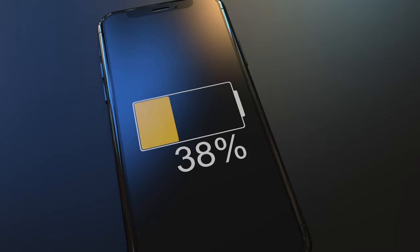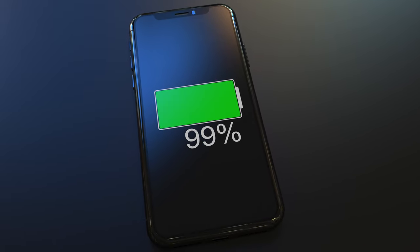Before the most recent DJI Fly app, this was a feature that iOS devices had to turn on and off. Then they released a new version where they took it away completely — you could not charge your phone at all from the controller. Now they've put it back, but iOS and Android devices will now automatically charge from the battery off the controller when it's plugged in. The only caveat is you can't turn this on and off, so your controller will always charge your phone and drain the battery slightly quicker. But the pros outweigh the cons — you can always rely on having your phone full of charge when flying.